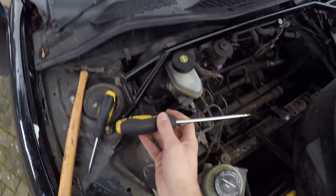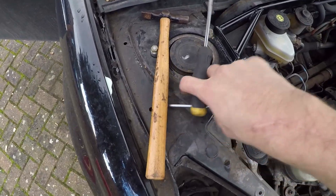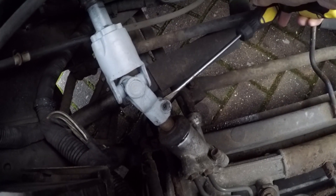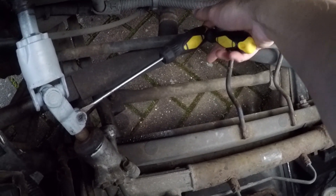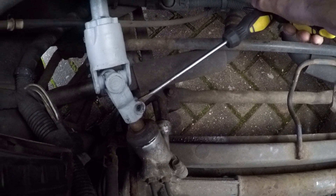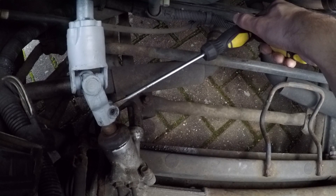Take a large flat blade screwdriver and into the hole at the top put any other screwdriver — it doesn't really matter what, as long as it fits. Use it to open up the jaws of that lower universal joint clamp: slide the flat blade into the gap between each half, then using the other screwdriver give it a twist. That'll open up the jaws, and then you can tap the other universal joint onto the input spline more easily because there'll be less friction at work.